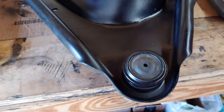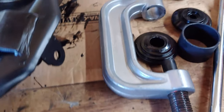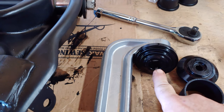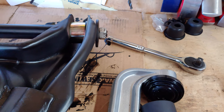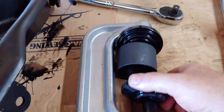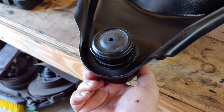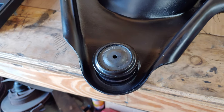Now, to get it started, a couple of blows with a soft blow hammer. The important thing is that it's straight — very important for it to be straight. I'm going to take this assembly. This goes to the top, and the screw of the ball joint will pass through it. That's the receiver, and then this is the pusher. We've got those adapters, top and bottom, and then this is the receiver. What it does is the receiver comes down here, goes on like that. Then we put that C-clamp over the ball joint and press it down into this receiver. And that's it. Easy as it is. Piece of cake.